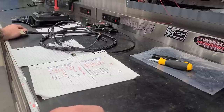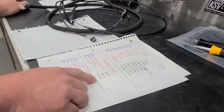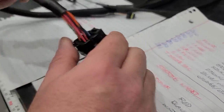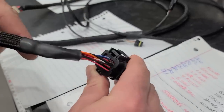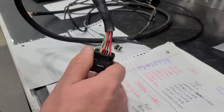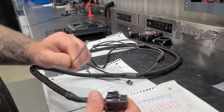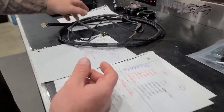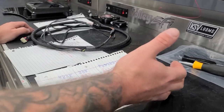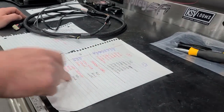If you wrote it all down — what color wire it is and where it belongs — it's a heck of a lot easier to look at your sheet and say, hey, button power is red and should be from B19, there it is. Trans brake button wire is black, that should be B24, there it is. Now you go to the other end of the cable and diagnose the connection. Once everything gets terminated, I put it all into an Excel spreadsheet, which gives you a nicer version with color, wire gauge, where it goes, and what it does.